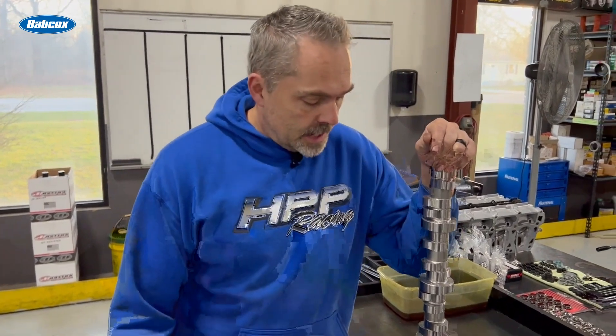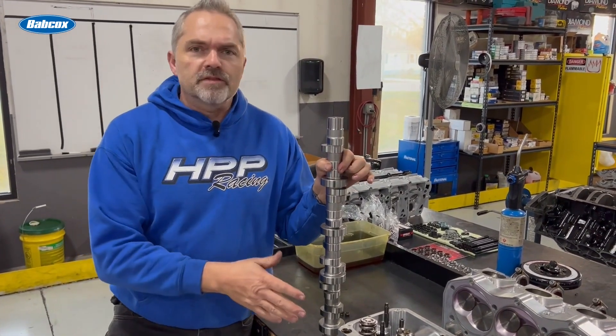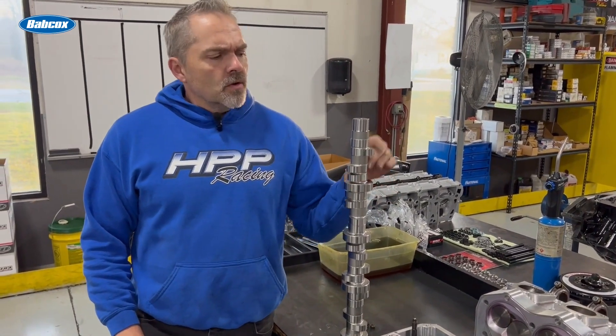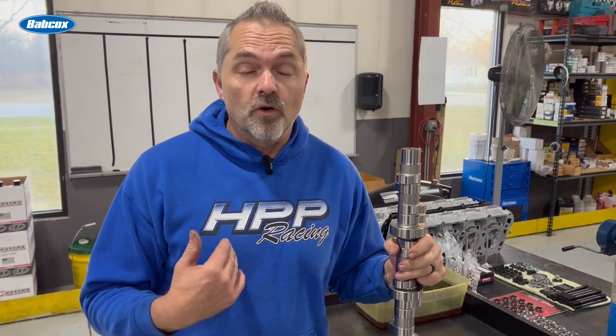So we have him send the engine that was in the car so we can go through it and convert it over to our stuff — put our camshaft and everything in it. We tear it apart, and this is the camshaft from it. I said, let's just see what kind of camshaft it's got, because holy crap, it has a lot of valve spring on it — way more than I ever run in these combinations. We run it across the cam doctor and this camshaft comes up within one degree of my stuff at 50 on the intake, on the exhaust — same lift, same lobe separation. It looks almost identical. But it had about 200 pounds more spring pressure on the open side than what my stuff needs. So I sent it over to my cam grinders, who have more precise equipment than a cam doctor.